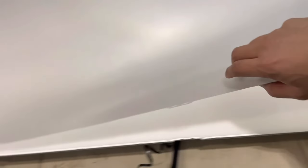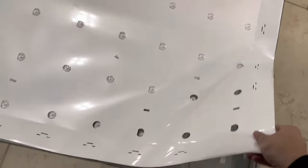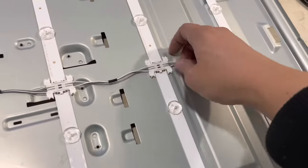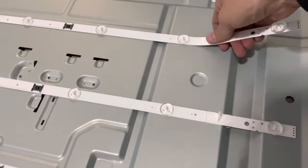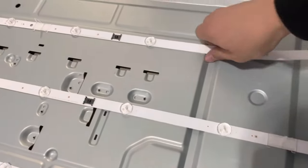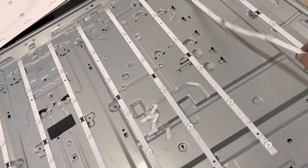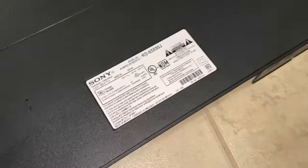Under the LED panel there are a couple of layers of white and translucent panels — just remember the order they come out, but they come out fairly easily. Behind the white paper sit the LED strips. Remove the very sharp white clips from the LED strips. The wiring pulls straight out very easily. The LED strips come up, but only after lifting with great force. And with that, we have completed the teardown of this KD65X80J. Thank you for watching and hope to see you in the next one.